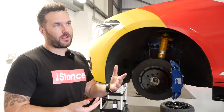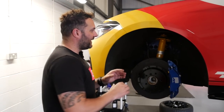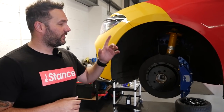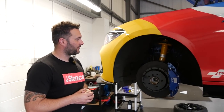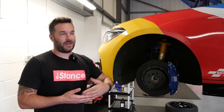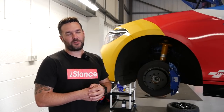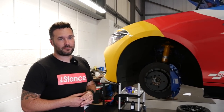It'll burn off, but I like detail. You look at a 911 GT3 and see all the detail behind the wheel — the caliper, the two-part floating disc. Imagine when your wheels are on it and your new wheels as well. When you start seeing Michelin — and obviously working with the wheel, which is for another video — it's details like a watch. Just the more you can see into it, this looks really good. We're going to bleed it now, then get it out, clean the disc, scrub them up, and then you can give a bit of a feedback report. I'll probably add some driving footage for first impressions. There's a bedding-in process — same as before on the EBC yellow stuff pad — about 350 to 400 miles fairly light use, then progressive stops. They'll probably squeal for the first 300 to 400 miles until the bedding process is done, and after that you'll be as good as gold. Let's get this finished off, wheels on, down off the ramp.